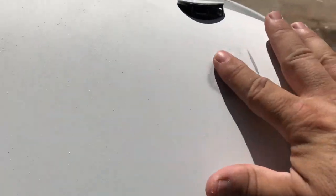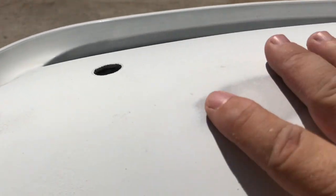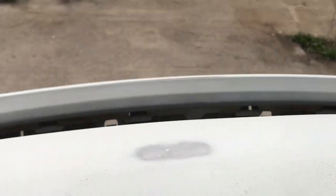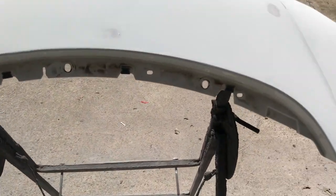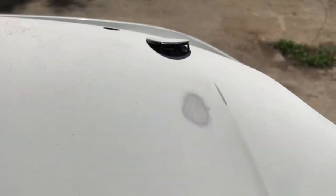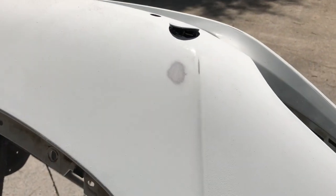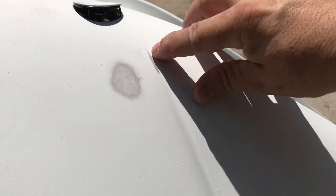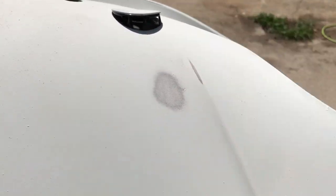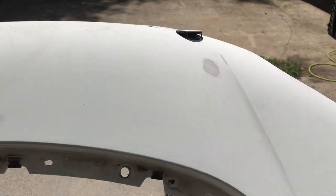You can see I had to sand all the way through to the plastic to even come close to getting some of these rock chips to go away. That's fine if you're going to be priming. Notice I sanded through the edge right here — you would not want to do that if you were finishing at 600 and painting over it, even with sealer, because it might show up as a little ring. But since I'm priming, going through the paint layers down to the plastic is really not a big deal. Now let me show you the spoiler.